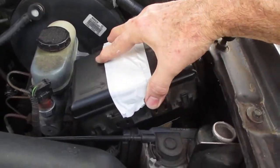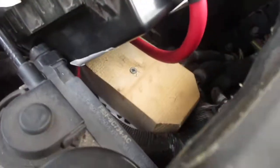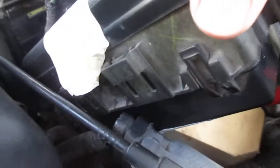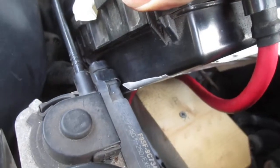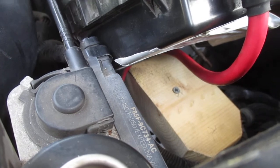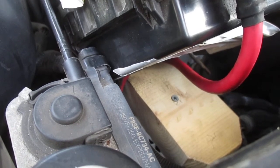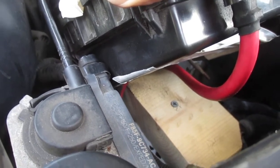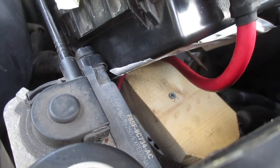As a shortcut, you can see I cut some two-by-four and shaped it — it's only about three to four inches long by about three inches wide. I put a screw right through the center and right through the frame. Before tightening the screw down, I put some adhesive caulking — you can use silicone or poly seam seal, as long as it says adhesive caulking — spread it all over that wood, press it down real good, then run the screw through it.